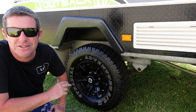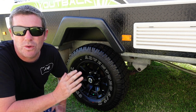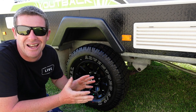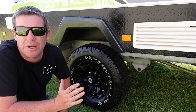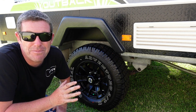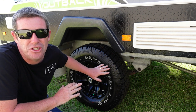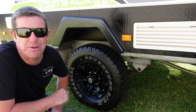If you are looking to upgrade your rims and tyres, on most of these that are 6 stud, the stud pattern is 6x139.7, which is common across most four wheel drives. The thing you have to be careful with is the offset, because these run a zero offset — which is sort of close to a GU or GQ Patrol. However, most modern four wheel drives these days run a more aggressive positive 25 to 35 or even 43 offset, which will sit the wheels too far in. If you've got a five lug pattern, typically that's a Ford stud pattern, but you do need to confirm that — particularly on older models they vary quite a lot. And the same goes for wheel bearings: you need to pull them off and check what they are, because they vary through all the different models and ages of camper trailers and caravans.